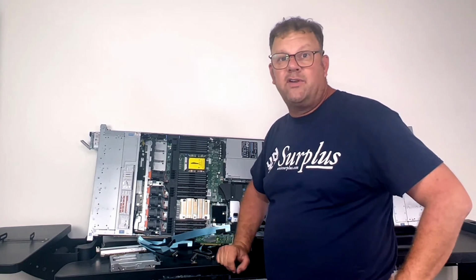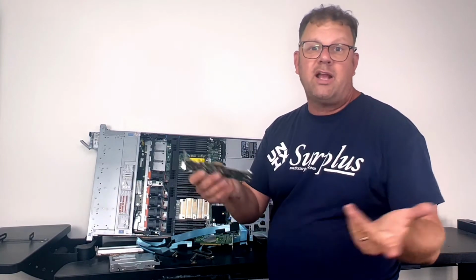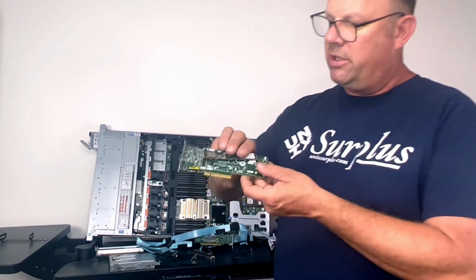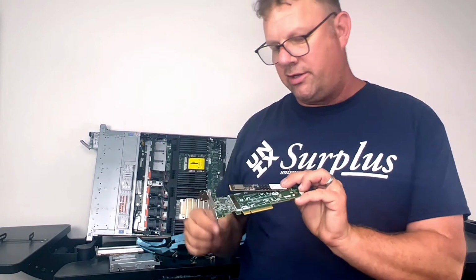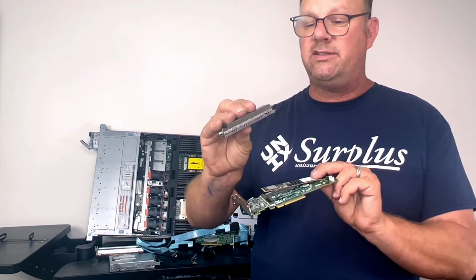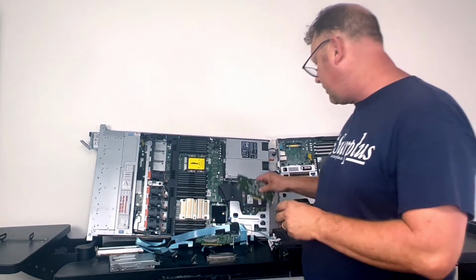The other way they did it, very simply, and you can still see this whenever you shop at Dell, was they came up with a BOSS card. The BOSS card is simpler, elegant, and fits in anything. It uses the smaller M.2 cards, so you can easily slip your little notched card in here. Sometimes you can even buy them with enterprise heat sinks too, if you're Facebook, etc., and you're going to run these streaming. And it just quickly plugs right in here.